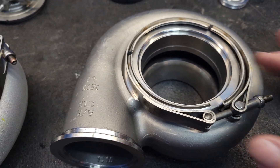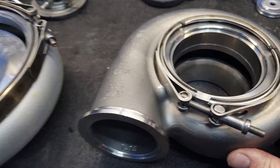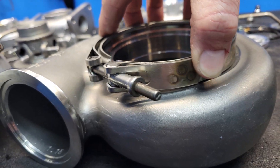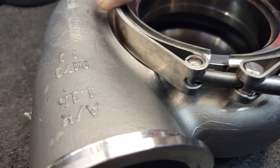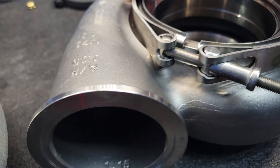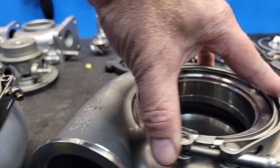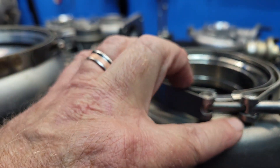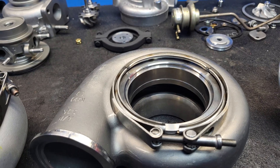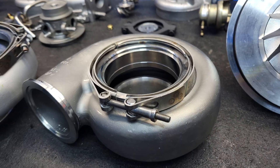So this assembly here — Garrett V-band stainless exhaust housing, the Garrett clamp that comes with it. It is very, very important that you check your clamp and make sure that it is not interfering with the turbine housing. This area right here is prime suspect. This is a small AR, this is a 1.15, and I've got clamp to housing contact right in that area. It is super easy to get these clamps on and have some interference between the clamp and the housing. What that will do — it will destroy this turbocharger quicker than you can recover from it financially.